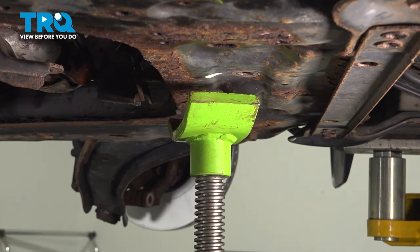Because the exhaust hanger stud had snapped, we're simply going to install a bolt on the back side of it. Install the nut on the other side and snug those down. Once these bolts are bottomed out, you're pretty much all set — just make sure that those are good and snug.